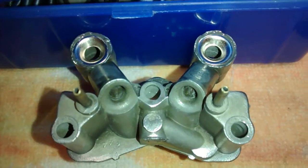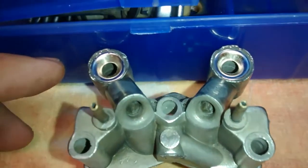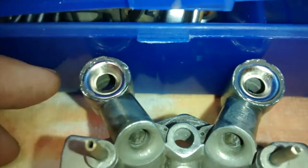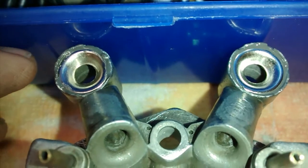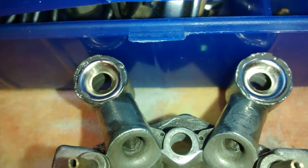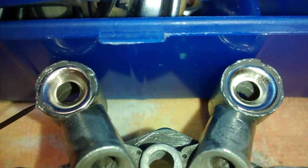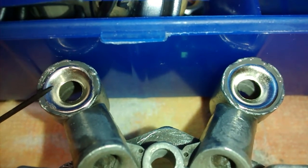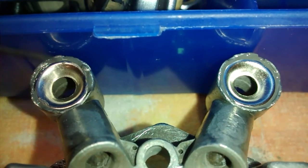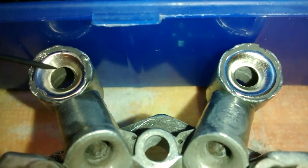I went ahead and placed these Venturi boosters inside the Venturi cluster here, and I can't really get too much zoomed in here without it getting distorted, but basically my initial method of trying to insert these was to taper these edges inward, this edge inward, this edge, and this edge, well, this edge you can't do, inward to secure this Venturi booster